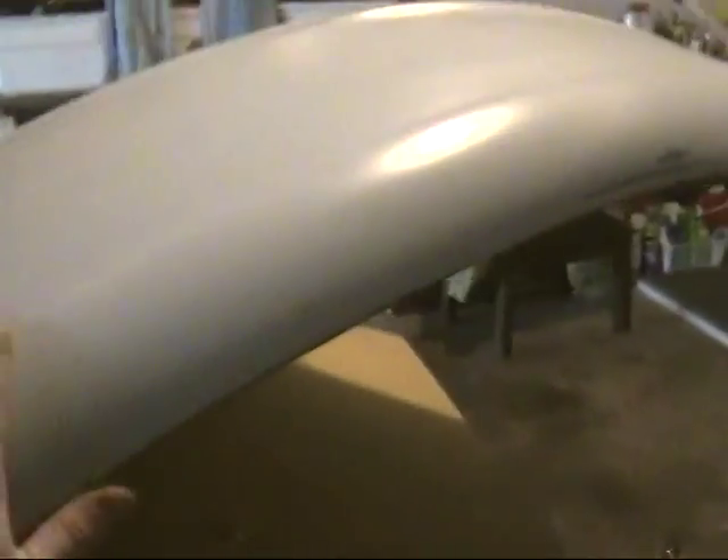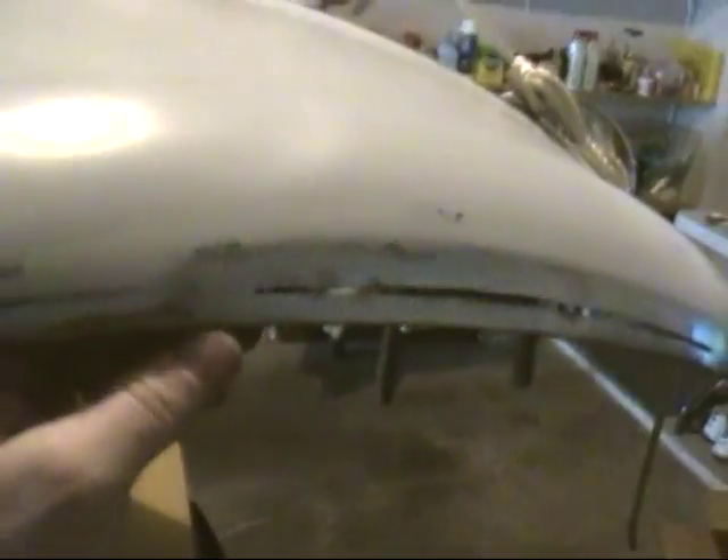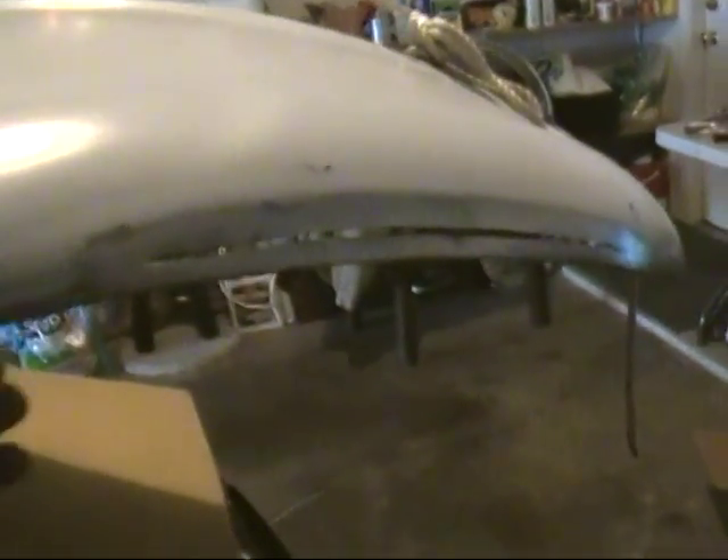It's a rainy day out here but I've been working on trying to get the hood to fit. It's pretty rough along this side right here - this car took a shot one time and I'm having a hard time getting it just perfect. Something really strange: when the hood lays down on the weatherstripping it just raises up right here where I've got this cut, and I can't get it to sit down nice and flat.